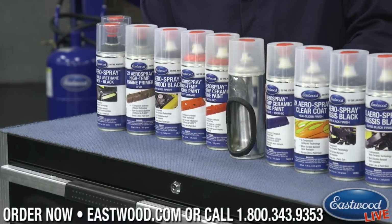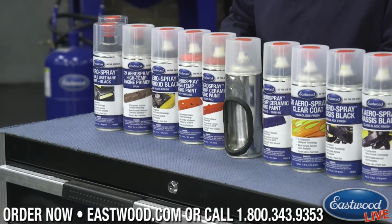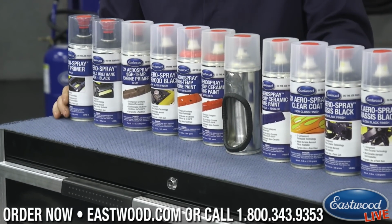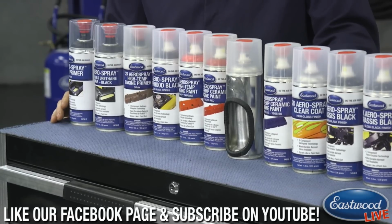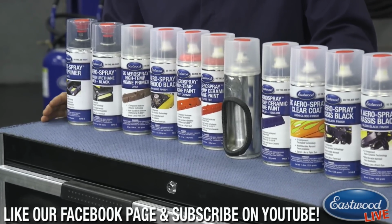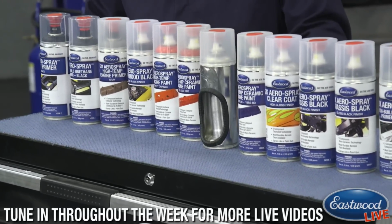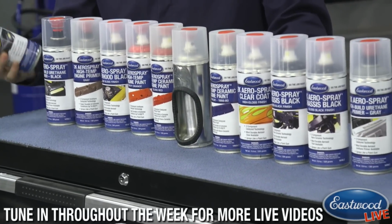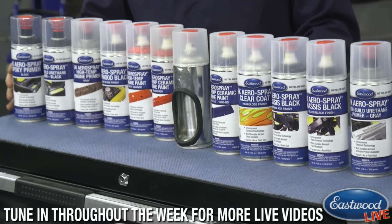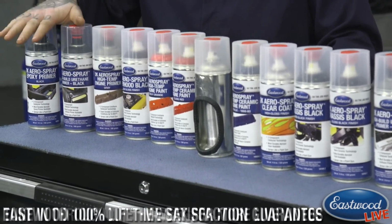Most of these cans cover about 35 square feet when you're covering out of a can. If you're doing something like a small chassis or something like that, you can probably get 2 to 3 cans. You can do a frame and get 1 to 2 coats on it on a small chassis. Obviously, depending on how much you're doing, it may vary. And then again, we have the epoxy primer and the high build urethane here on the end.